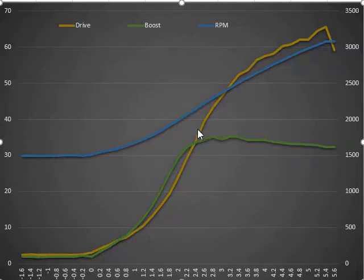Another thing with this setup is that because it's drive pressure referenced, it'll actually start to open sooner at higher RPM, which for a towing setup works really well. I'm really happy with how the spring gate works - you can't really ask for a whole lot more.